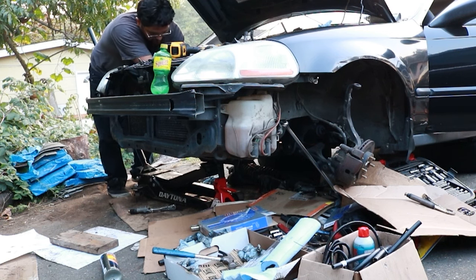When I first did the Y8 intake manifold conversion, the idle kept dropping down too low — it seemed like it wanted to die out and did die a couple of times. So I opened up the idle air control valve some more: twist it a little bit, let it run for a minute, twist it a little more. I think I also had to put it into maintenance mode, so make sure you do that — double check on that.